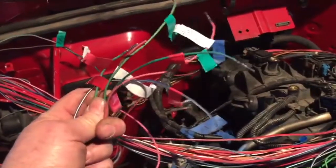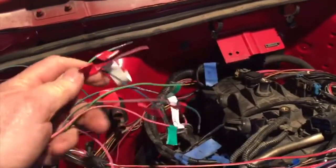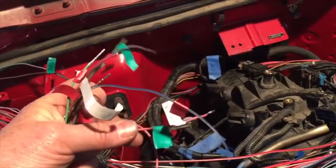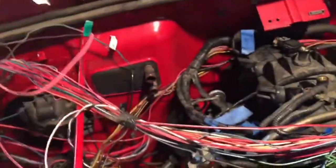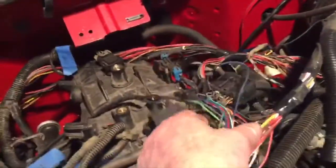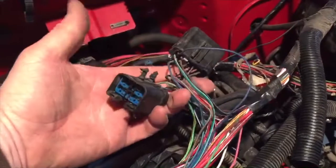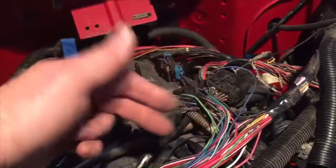The next step was to take all the wires that were out of that C plug - the third one in the PCM - which I disconnected last night. I've identified them with red tape, which means I do not need them; white tape, which means I'm not exactly sure; and green tape, which means I do need them and they're going to go someplace from the distribution block and tie into the LS wiring. Now that these are all marked and identified, I've started to take them out. These two plugs that used to go to the engine management and back to the fuel pump and transmission will be deleted.